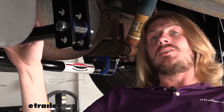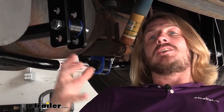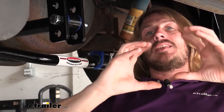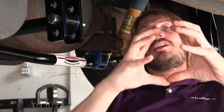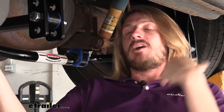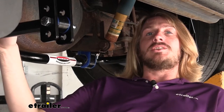Lastly, I'd also recommend a steering stabilizer, which installs on the front on your drag link bar that goes across. Whenever you hit a pothole, you've probably been in your motorhome and it jerks the wheel real hard to the left or right based on where that pothole was. That stabilizer has a shock dampener that will absorb some of that road impact so it doesn't jerk as hard. It also has a spring mechanism set at the center position, so if it does jerk one way or the other, that spring mechanism is also going to help pull the wheel back straight. All those things together really do a great job of taming these big old beasts, giving you control and making it an easier time so you're not white-knuckling it all the way to your destination.